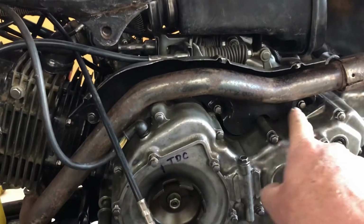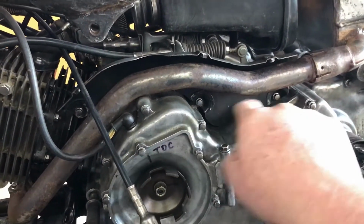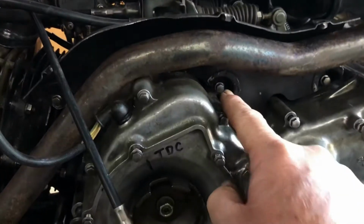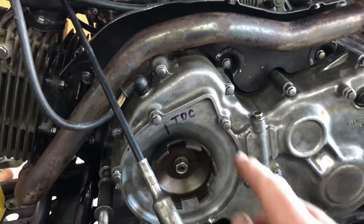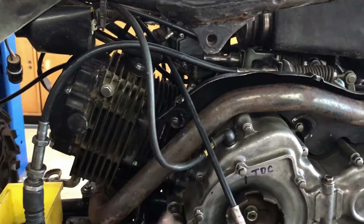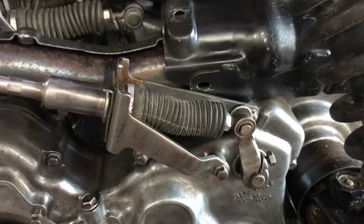I've even found these bolts on the spare motor in order to mount them with the correct looking bolts. I used bolts that are equivalent to the ones that come out of the recoil starter there. They're little short 8mm heads. So I've got the correct bolts in there. I've got a new tapped hole and a fixing there. It's all looking pretty damn good.